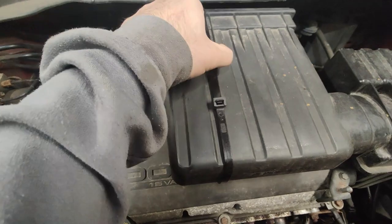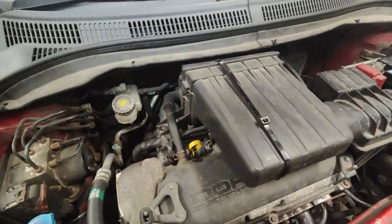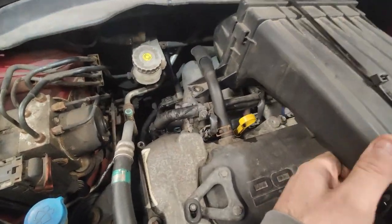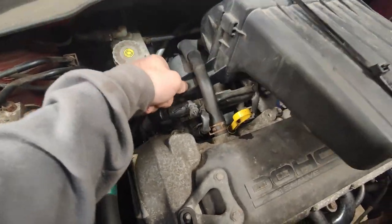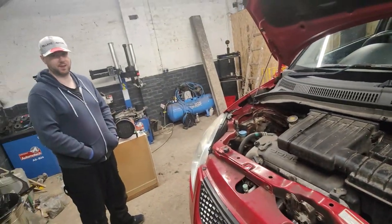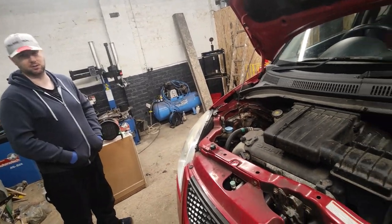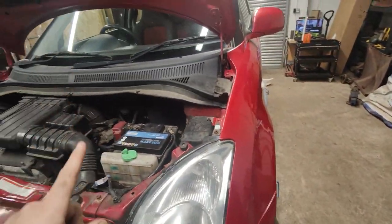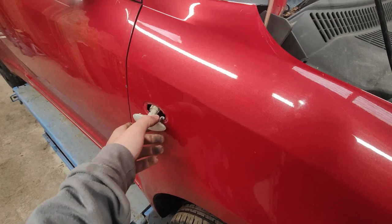This air box has been cable tied, as have two of the back brake pipes — they've been replaced but the ones that run the length of the car have been cable tied on. This section is cable tied because the clip is broken and there's no stay, so there's a bit of play. Engine management light is on. Gary reckons disconnecting and reconnecting the battery clears it, but it's come back a second time so it's probably a real issue — and no one's actually diagnosed it. We will do a code read and reveal the price as well.